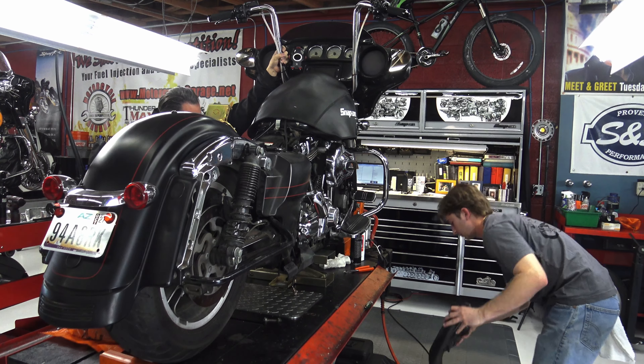What I want to show you is a couple of things: the tins are loose, screws are missing out of the fairing on the back side — one in the upper left-hand corner. Also the ABS sensor is on the wrong side; it should be on the other side. They have the wire coming across and over the top of the fender. Whoever did this obviously didn't know what they were doing, and that's why you come to the Motorcycle Garage for our expertise.